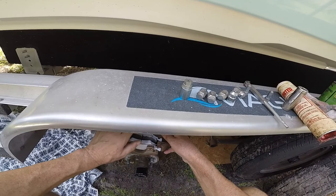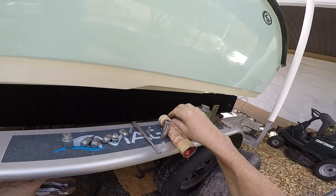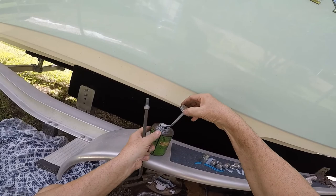This is really very simple to do, but what gets you is the pads start rusting up and they fuse in there so they don't move anymore and they lock up on the rotor — that's why your wheel doesn't move. Now I'm going to get these cap screws in, and they had no lubricant on them when I took them out and they fought me the whole way.